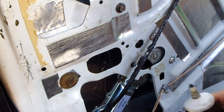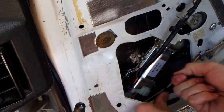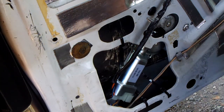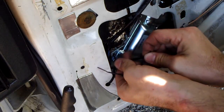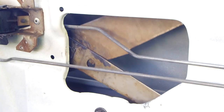Grease the gear. Use zip ties to reinforce the window motor — the zip ties will keep your window motor from vibrating inside the door panel. Make sure the window will roll up and down completely without binding. It's a good idea to lubricate the window mechanism.